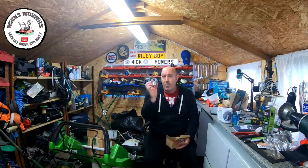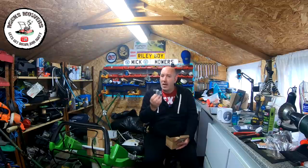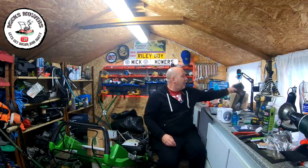On top of that, I sent off for this — five months ago in March when we first got locked down — and it's just turned up, been in shipping for about five months. This is the original carburetor for the six-and-a-half horse Briggs Intec — the original engine on the ride-on. I'm going to be swapping it back because the needle and seat had gone on the old carburetor and it's severely corroded. This one cost me 11 pounds where a genuine would cost 40 to 50 pounds, and it comes with all the gaskets and a free set of carburetor files.